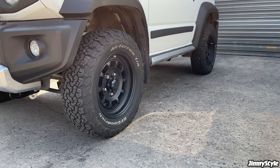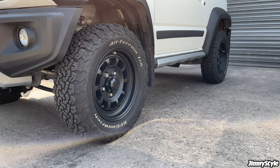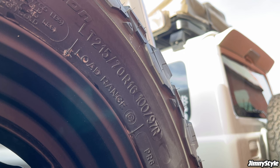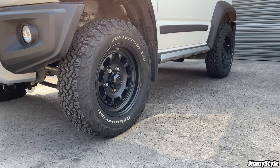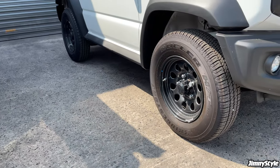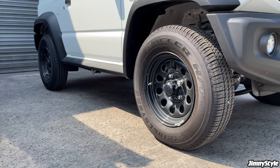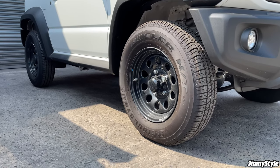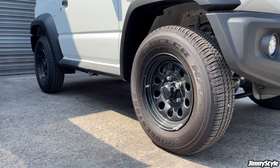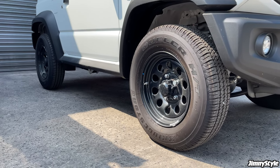To kick things off we'll start with the wheels and tyres. This is the setup on our SZ5 Jimny — 16 inch High Peak J01 wheels with BF Goodrich all-terrain K02s in 215/70R16 sizing. This Jimny has been lifted 40mm but this specification and size does work on a Jimny with standard suspension. By comparison, these are the standard LCV commercial steel wheels. They're 15 inch, an inch smaller, and come with Bridgestone Duelers which aren't the worst tyre off-road, but on-road they leave a bit to be desired in grip and comfort. These come in a 195/80R15 size. So we're going to swap those for a set of the High Peak J01s.